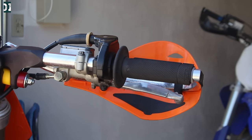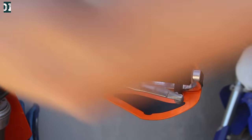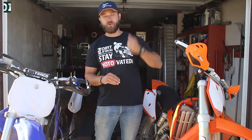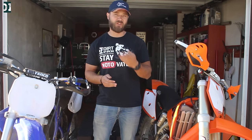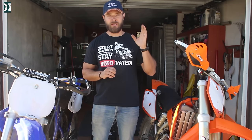So this is how I set my idle on a two-stroke dirt bike. Hopefully this video will help you set your idle whether you ride a 125, 250, or 300 — whatever you ride, you always have that air screw on your carburetor. Remember to keep a screwdriver in your backpack when you go riding, because when elevation or temperature is changing, you still need to play with that screw. It's not set-and-forget. You can hear how the bike is running and feel the throttle response — just fine tune it so your bike is running at its best.